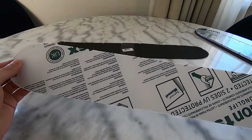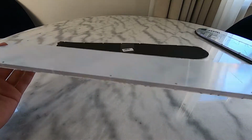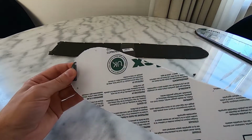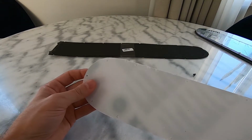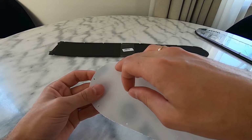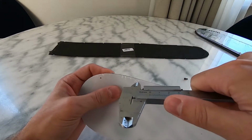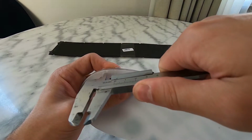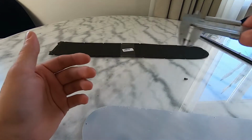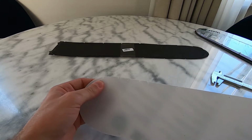So as I said, I am in the process of improving this, but if you go to buy this version from me, be prepared that for white versions of the scooter there might be some problems. But once more, I would speculate that it can be easily fixed by drilling a bigger hole here. So far it has 3.1 or 3.2 millimeter holes. I don't remember exactly, but let's try to measure. I think it's 3 strictly or 3.1. So it can easily be drilled to 3.5 or even 4, and then it will fit.